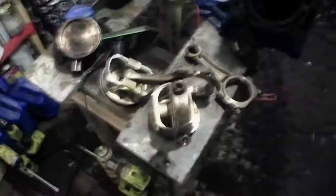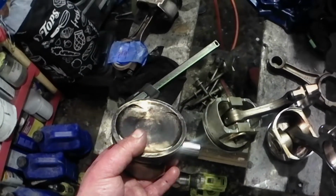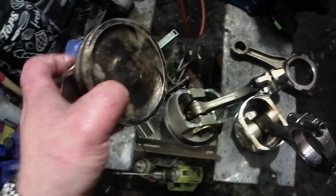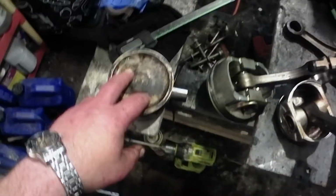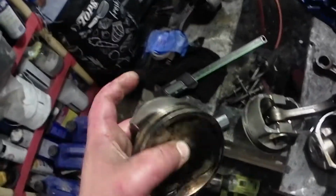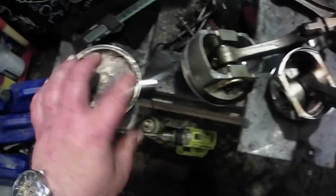Now let's compare pistons. This is out of an EJ-257, I believe. Yeah, it has a lower compression height, more dish volume. I believe it's the same thickness. I don't have a tool to measure exactly how thick the center is, you know, from my finger under here. Wrist pin size is the same between all three of these guys.